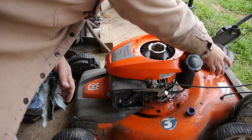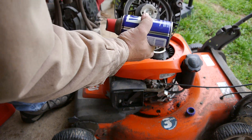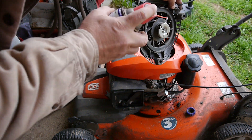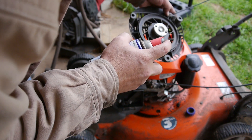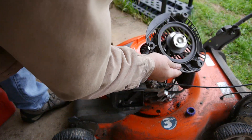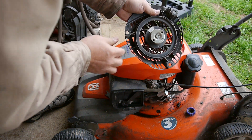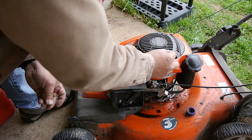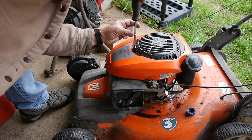So let's put the covers back on. And your pull rope — this one looks to be in good shape. A lot of times if you're pulling it and it feels gritty, I get some WD-40. There are a couple of spots in here where your coil spring mounts. Usually there's a little hole where you can spray some WD-40 in and rotate it around, so that makes sure your coil spring is not corroding in there. Keep it running smooth, especially if it has been left out in the rain — spray some WD-40 in there and clean it out, or you will be replacing it one of these days.